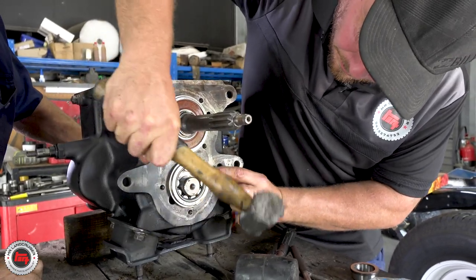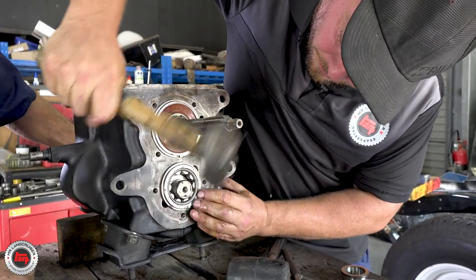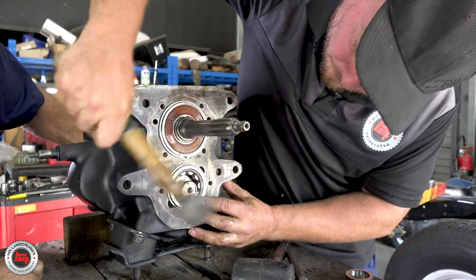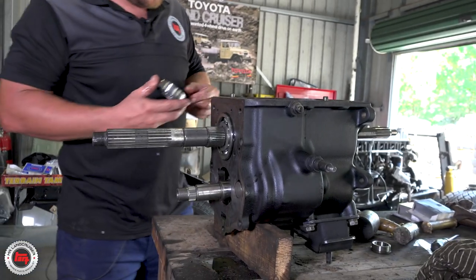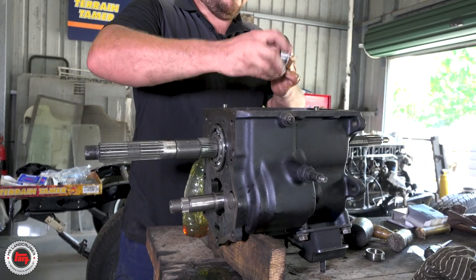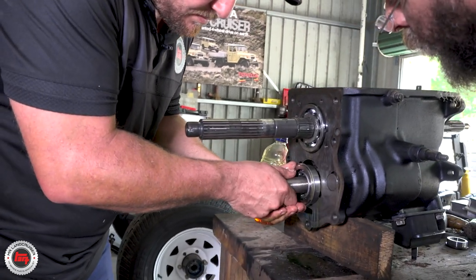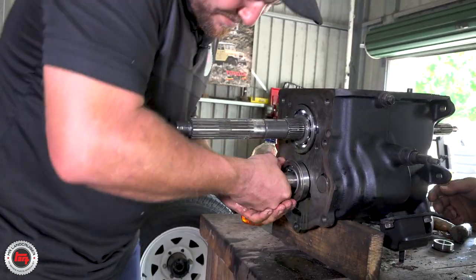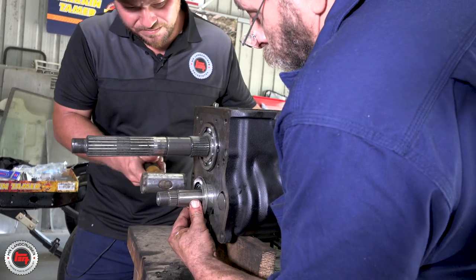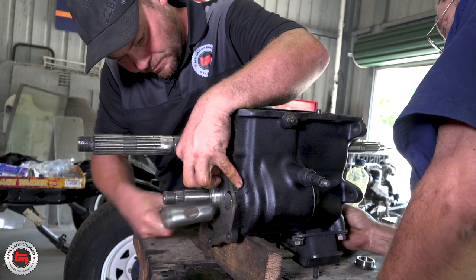Who's giving you a hand in the background? That's Mick - he's a gearbox specialist by trade, so he's very handy to have around. You had to hold the shaft up to get the bearings in. Heaps of oil on everything. There's Mick with the big back bearing going in. This is quite an integral part of the build - if any of these gears are touching and you hit the wrong part, you'll knock a tooth off. You do not want to do that at this stage, so it's good to have two eyes looking at it front and back.